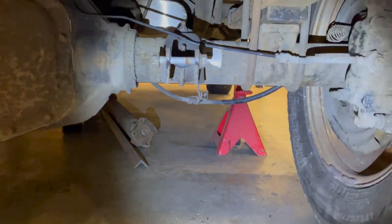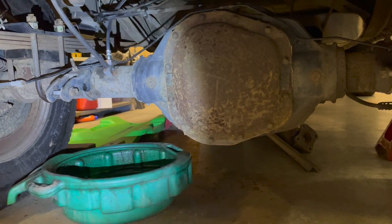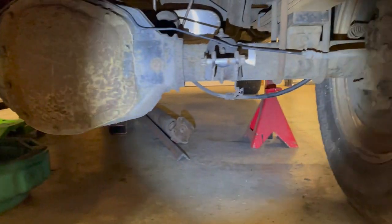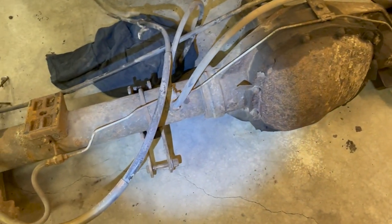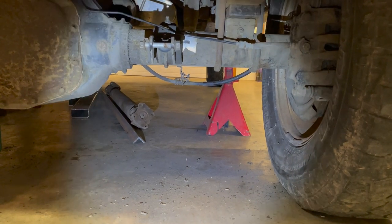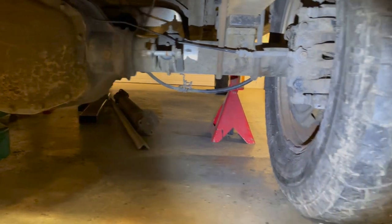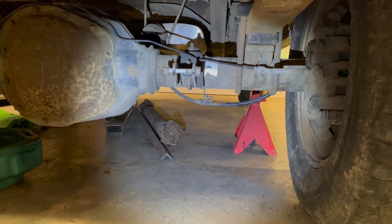I played with these shock mounts and flipped them over like I said, but I hate it. They are two different mounts — one was for the front, one was on the back — and they just don't work right. What I'm going to do is pull the shock mounts off the Excursion axle and flip them over, because they are the same, and when I flip them over they'll sit at the same spot. The reason I want to flip them over is clearance — that's a big deal to get the rocks slid underneath it. My suggestion for you if you're just doing a stock swap: put the mounts from your Excursion axle on here.